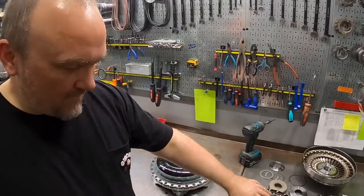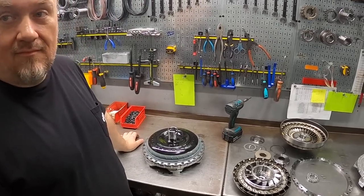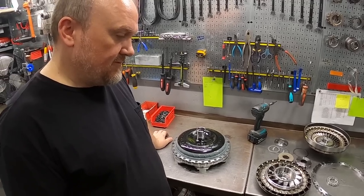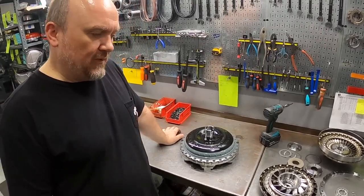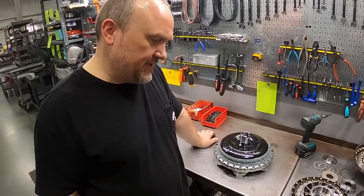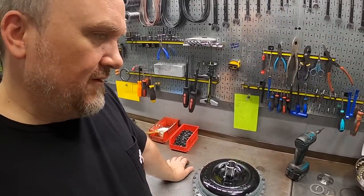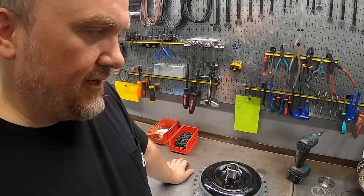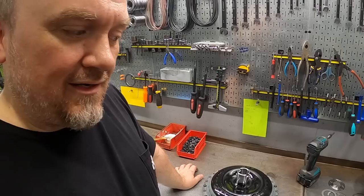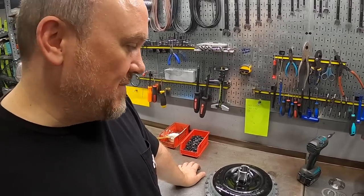It's also worth mentioning, Pete, that if you've got a bolt together converter, although it probably goes without saying, don't mix and match manufacturers of stators with rebuilds or assemblies of converters. Yeah, generally that's pretty difficult to do, because in the converter world you have a lot of great options with all the different brands out there, a lot of highly performing converters from various builders. But it holds true throughout the industry that whether you're looking at one of ours or one of our competitors, the parts are different enough that usually they aren't going to freely interchange. So it does make mixing and matching more difficult.